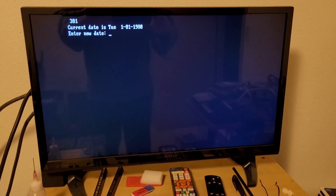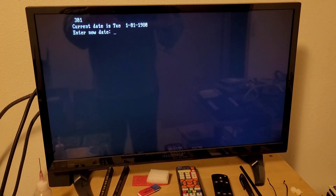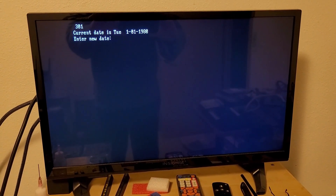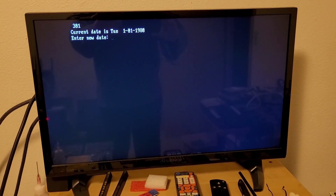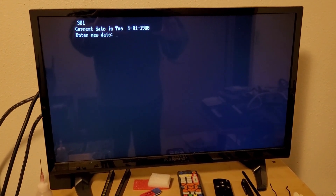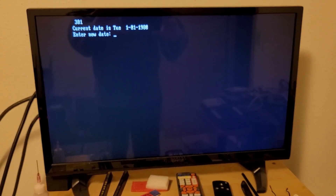Here's the latest display I'm getting. I looked up the 301 error and that is indeed the keyboard being absent, which is absolutely correct — I do have one on the way. The flashing display issue was just a matter of downloading the latest software for the RGB to HDMI and putting that on the memory card. That's super positive, very cool. I'm very happy to see this machine actually booting and working. Hopefully you enjoyed watching me put it back together and take these first initial steps. I'll let you know more when I have more to show. Thanks for watching.